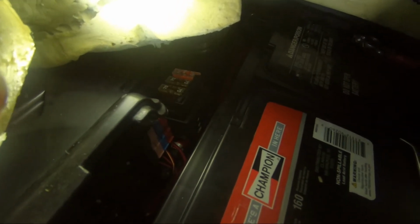If they wiggle loose, it'll look like they're plugged up, but it won't be. Reach your hand down in there, make sure they're plugged up there good, or else you'll get a code for the SAM module, voltage below 7 volts, under voltage.